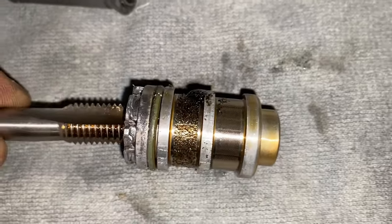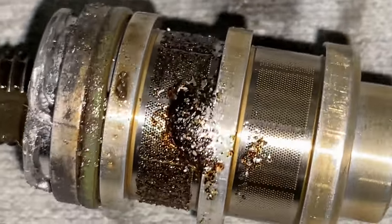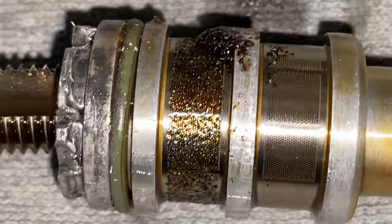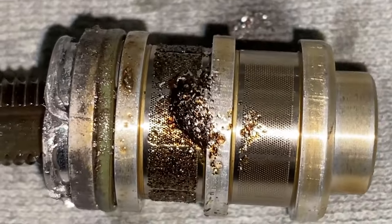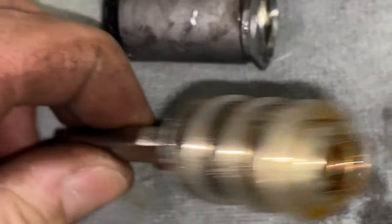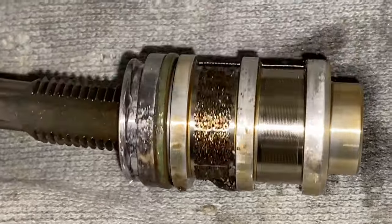These fine mesh filters, they don't really do anything. They really don't. You can zoom right in on that. Look how bad that is. So that's a good example of why, if you've got an N43, you should do this as a service item, maybe every 20,000 in my opinion. Just put some brake cleaner or carb cleaner in it, whatever. Bearing in mind that you really need to clean them from that side through the hole and try and work them up and down if you can, somehow by tapping them. If you try and go through the mesh, you'll be pushing it all inside, really.